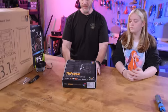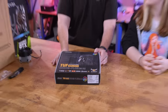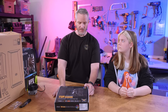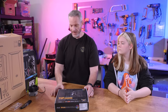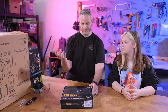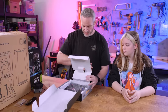We are using the Asus TUF Gaming B550M Plus WiFi for no reason other than it's the only micro ATX board I have in the right chipset to use this CPU without any features being omitted. By features I mean PCIe Gen 4, which we actually don't need since we have a SATA drive and a 20-series GPU. But there's some future compatibility to this board — if you want to update later to a faster CPU, GPU, or M.2 storage, it's capable of doing it. So let's get started building.